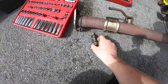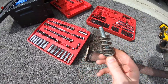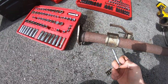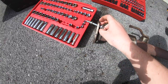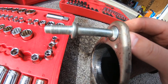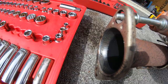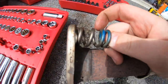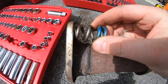But you can see that the way this guy works is it's got a spring, and the spring seats on the bolt and at the top of the flange. But you can see that this little flange right here, this guy, he actually passes through the flange of the exhaust and it seats right there. So it would seat fully like that if it chose to, right? And that's where the spring goes. The spring actually presses up against this and provides, I'm not really sure, maybe dampening of vibration in the exhaust